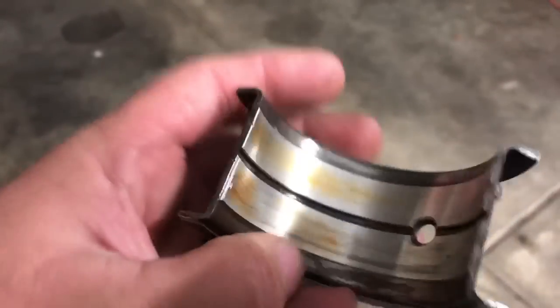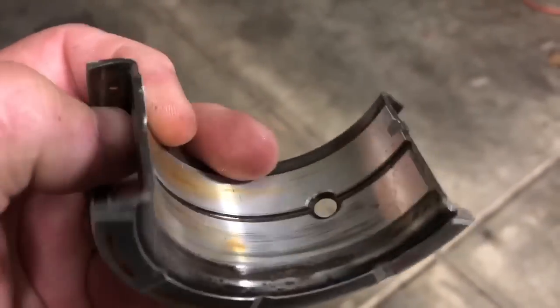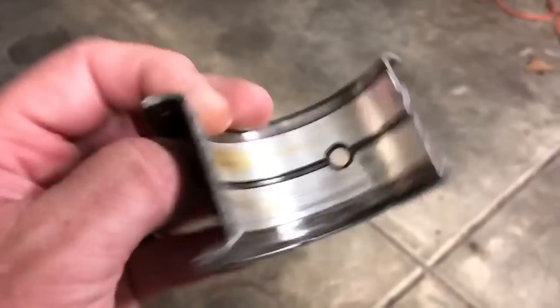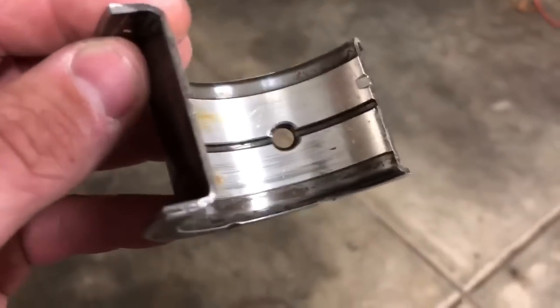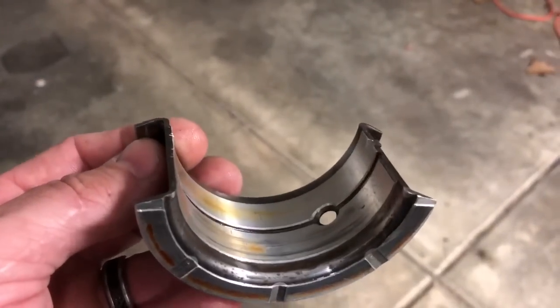Just some tips and tidbits — if you're not doing this to your thrust bearing, it works on a small block Ford, it works on any type of motor that has this type of bearing. If you have one of those mod motors where the thrust bearing is separate, I know EMMR sells a roller thrust kit, but any traditional bearing you can do this to. If I had a naturally aspirated car I might even consider doing this. It just makes it better when you get more oil. Drop any comments below, don't forget to like, share, comment and subscribe, and we'll see you next time.